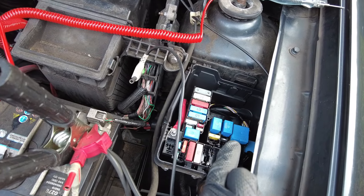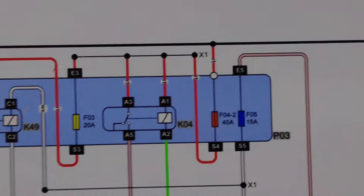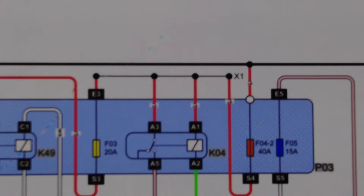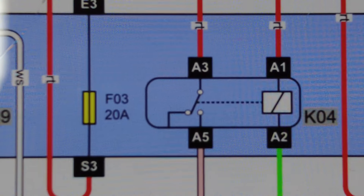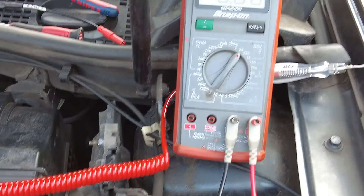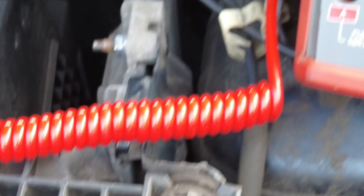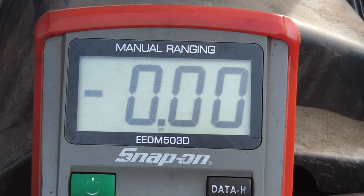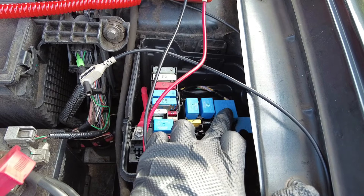We can eliminate a lot of things by testing the relay side. We're going to test Q4 and Q3 — these two power supplies get switched over once the engine ECU grounds the relay, then it switches over to A3 and A5 and supplies the engine ECU with power. Back-probing directly into the back of the engine ECU on that wire coming from the engine ECU relay, we can confirm we've got no power going there.